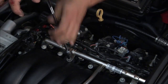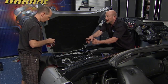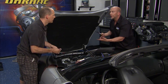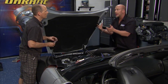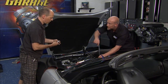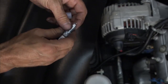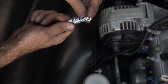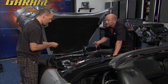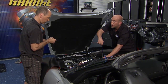Alright, Rick and I are buttoning up the top half — new injectors are in, valve covers drilled. Now we're changing plugs. We've got Champion Iridium plugs. You want to run a cooler plug because you're putting more air and more fuel in there, making cylinder pressure a lot hotter. We have to close the gap down to about 35 thousandths and run a couple of steps colder to keep the plug cooler.